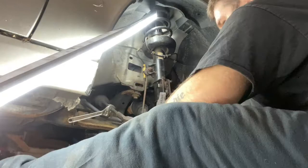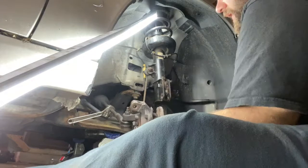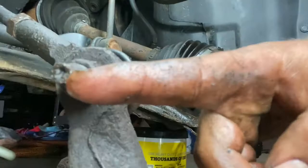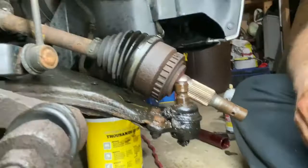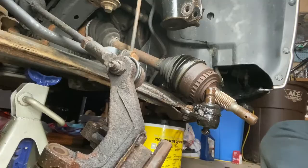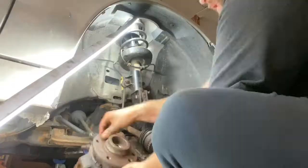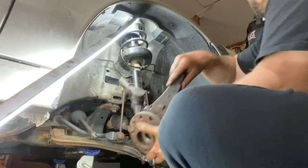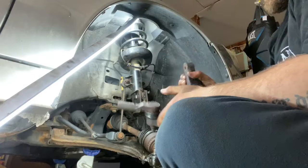Once I've got movement in that, I can rotate it off and move on. Now I'm going to hammer out this last nut — the whole knuckle is going to come out. Now I've got the whole knuckle, and I'm just going to spin it right off the tie rod end. The ends right here have a little inside to them that you have to hold while turning the nut to do your tie rod ends. They're so rusted I stripped out this middle piece, so I'm going to replace these tie rod ends while I have the whole knuckle out.